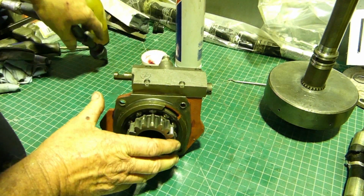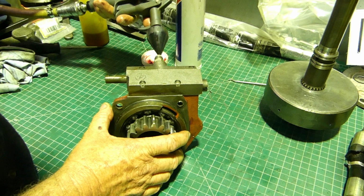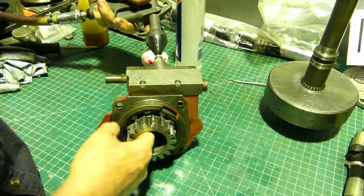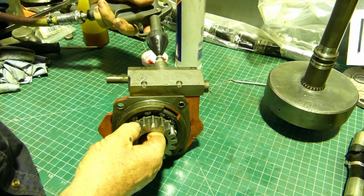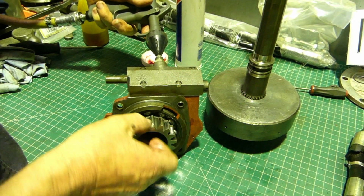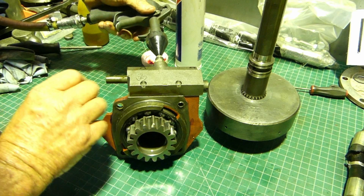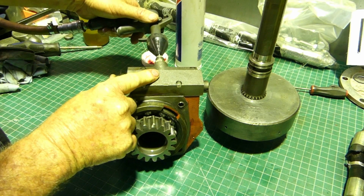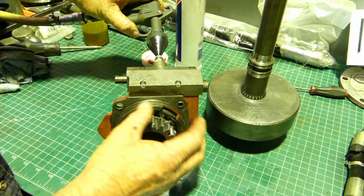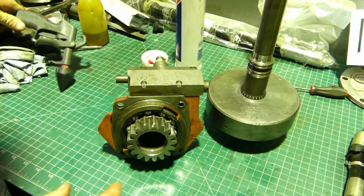Now, when we put air in here, and this valve is in this position, out as far as it can go, we can feel inside, and the oil port that supplies oil to the multi-power pack here, you can feel the air coming out the holes. So when you flick the valve on the dash, all that does is pop that in. No oil there, but it's coming out here. You can feel oil pushing through this front bearing to give you a bit of lubrication.